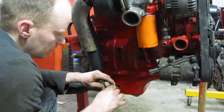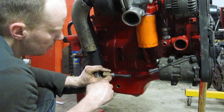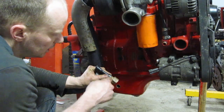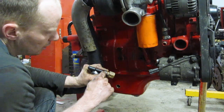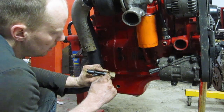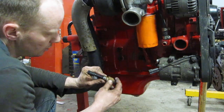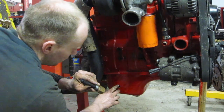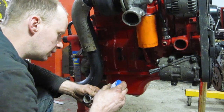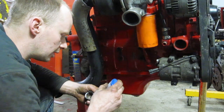The threads were just off, so what I did was take the plug and bore out the center, then shave off the threads on the lathe. I'm going to Loctite it, spin it in, and then bang it nice and tight so that the plug slides onto the collar of the sensor. When the Loctite dries I'll give it that extra little twist, and the O-ring will seal around the outside. Hopefully I didn't machine it too tight — you want it nice and tight, otherwise you're going to have leaks.